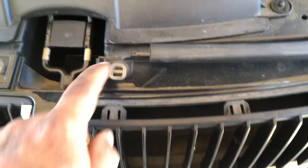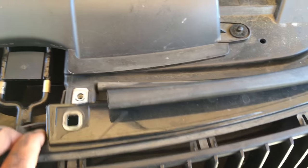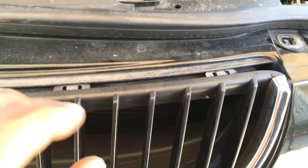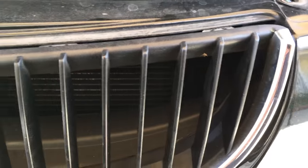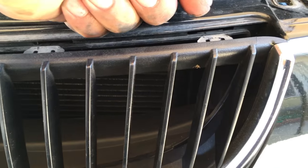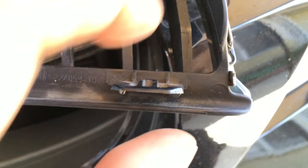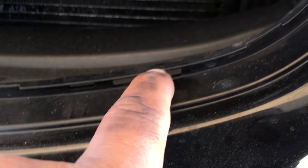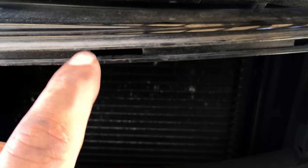Once you remove the three or four bolts on top, the bumper will be very loose where you'll be able to have access behind it. What you want to do — I needed my two hands to do this so I couldn't really record it — I was holding my right hand pulling the grille towards me, and in the back of it using my fingers pushing these clips right here, right behind it. I was pushing them up to get it past these gaps right here so the grille can come right out.